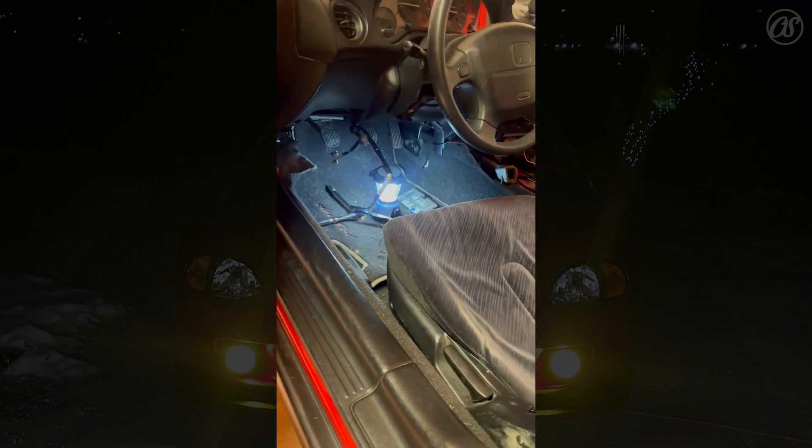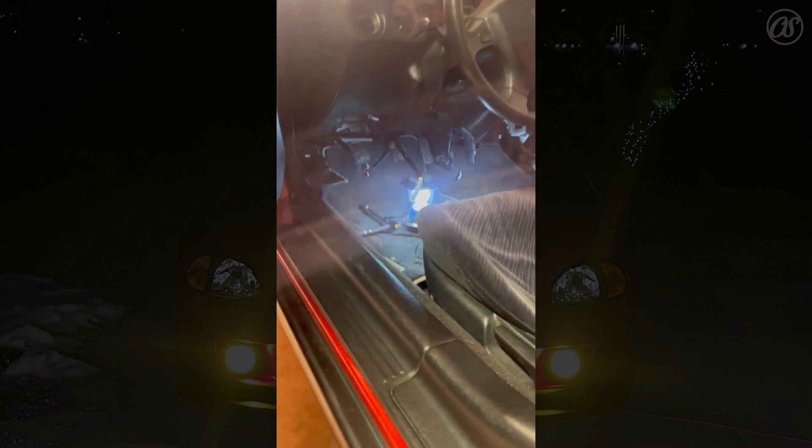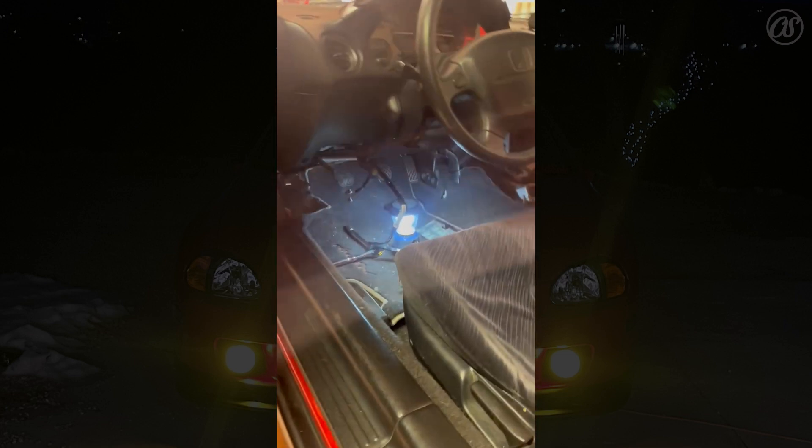In my test run I plugged these into the key-on ports. I want to be able to turn the fog lights on without my headlights on, and I didn't want constant power just in case it drained the battery. So I'm going to use the orange ports — the key-on accessory ports. First bundle recap: switch by the e-brake, down through the dash, relay and ground, plugs into the accessory ports on the fuse box.